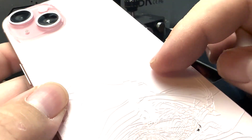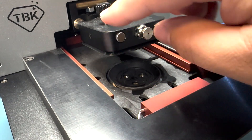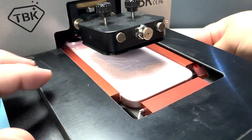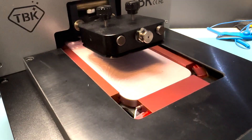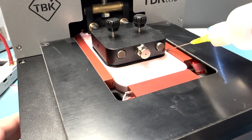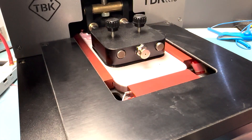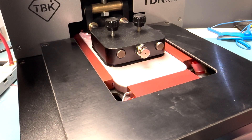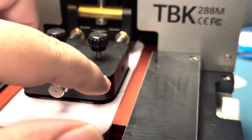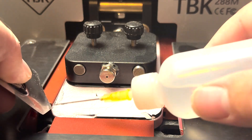Due to the matte finish on this glass, using packing tape to help with suction isn't really effective. That's why having a constant vacuum is good, because you're going to be losing suction with the cracks. This should be sufficient to lift it. We're going to slide this in, spin these, clamp it down, make sure it's pushed all the way back, and start the vacuum. I'm going to be using some isopropyl alcohol here to help lift it, putting it down along the border to get that gap. Now we'll start to lift.